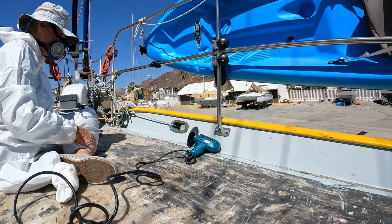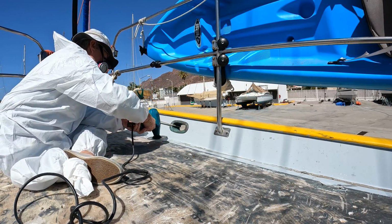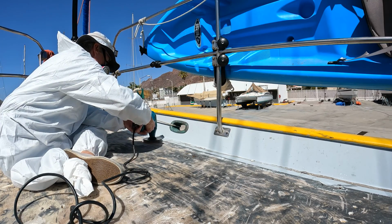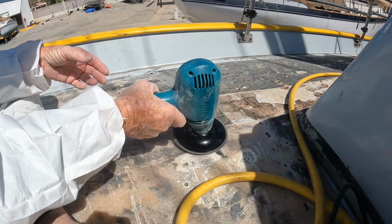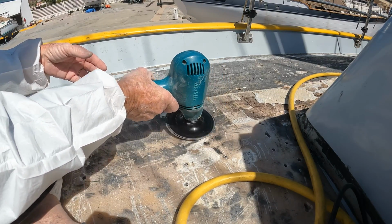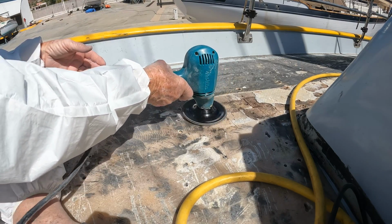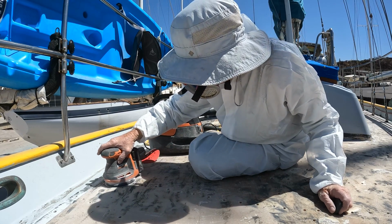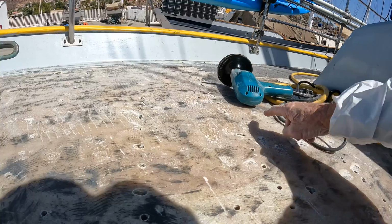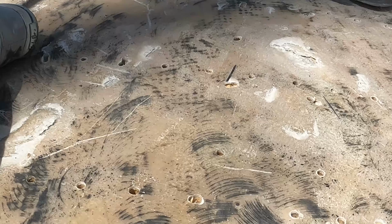A good portion of the sanding was accomplished this week. With the increasing heat, my bunny suit, to keep the fiberglass prickles away, was uncomfortably warm. I view sanding as one of those jobs that must be done and is best performed with patience. The sanding revealed gouges in the deck from the chisels used for the teak removal, and the gouges will need to be faired.